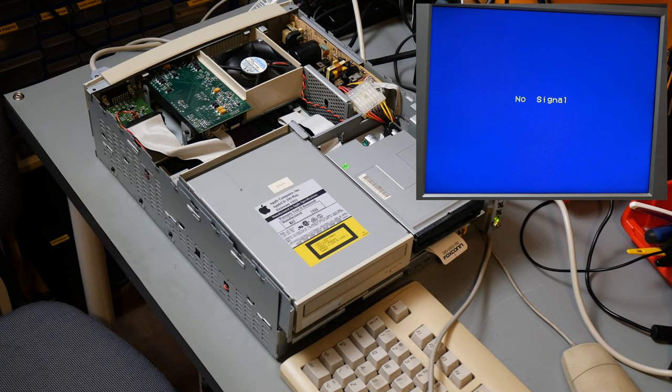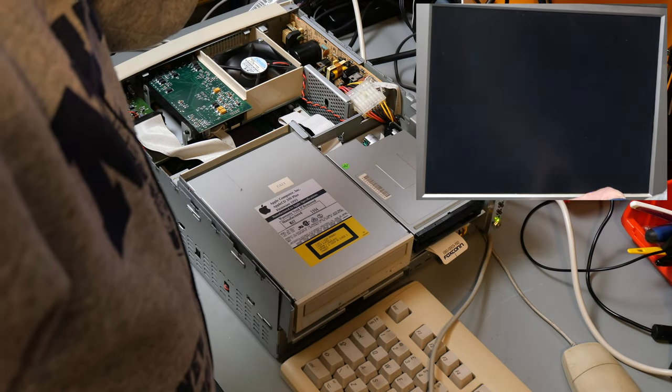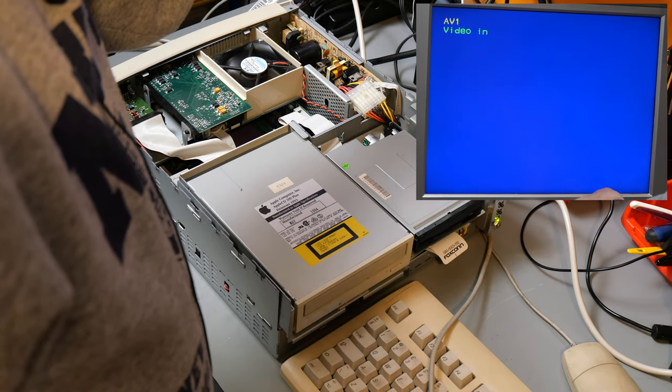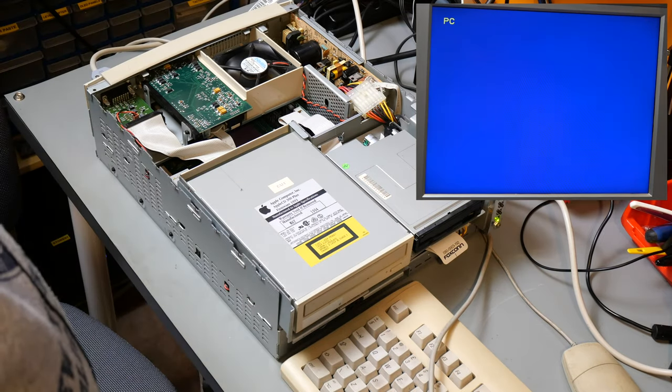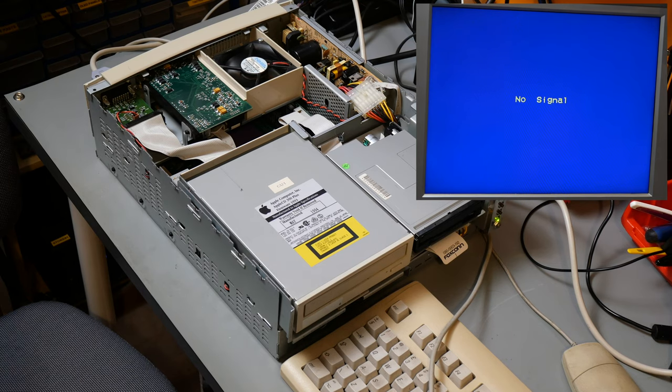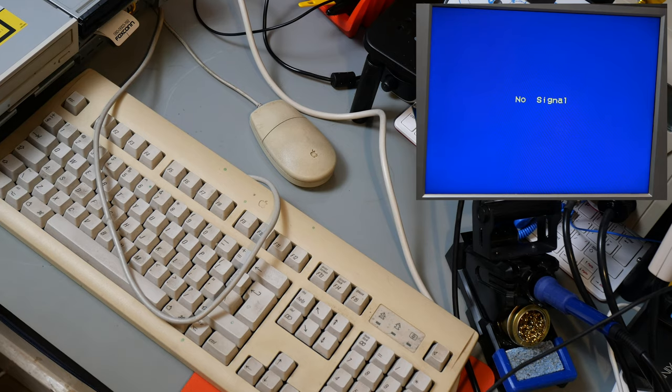Stuff is rattling. But I don't know at the moment whether there's no video being output or whether the TV is not displaying VGA. It's definitely on the VGA input. However, we definitely had signs of trying to boot. At least signs of disk activity. The caps lock light comes on when I press the caps lock, so at least something is working.